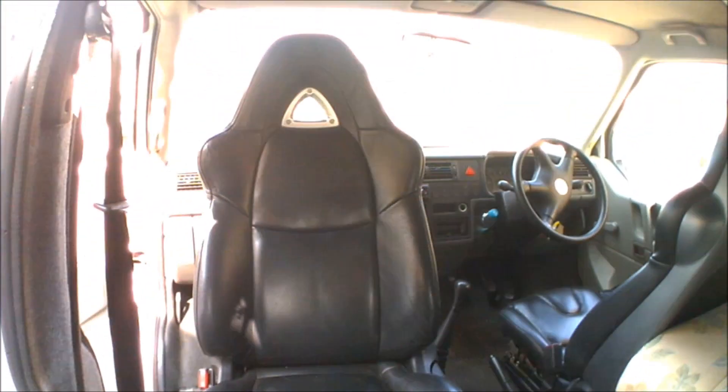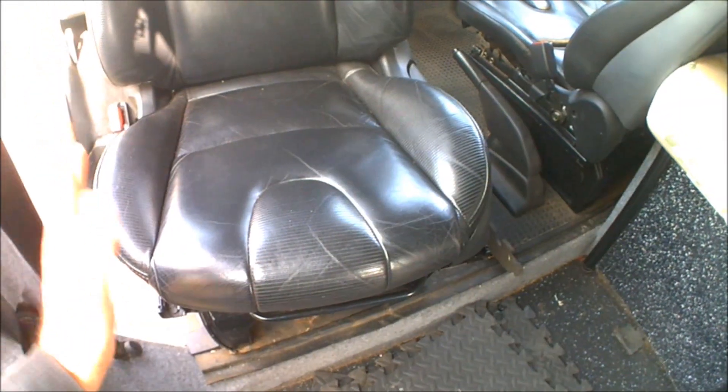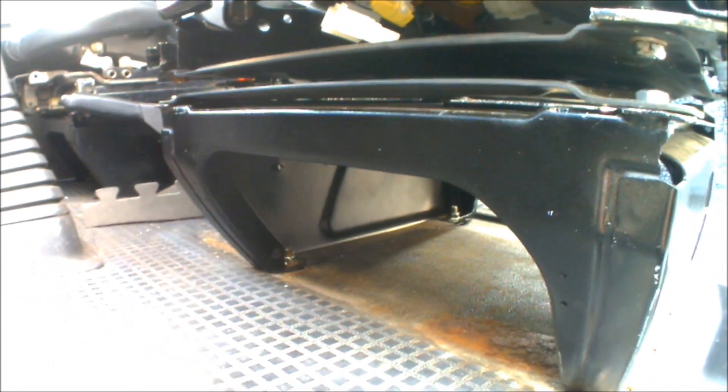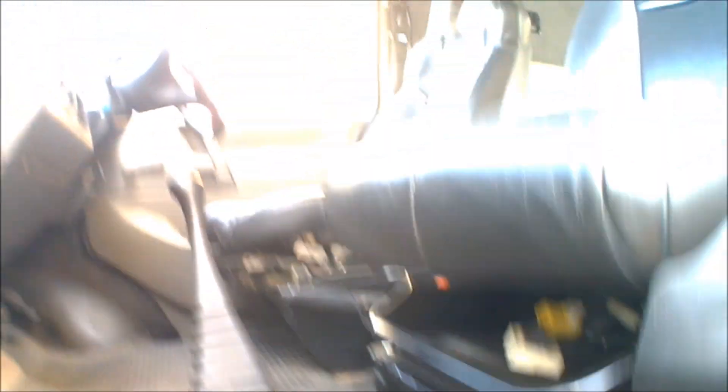The seat just folds back into its position again. So that's the passenger seat fully facing the back of the van, still free to move and swivels really easily — just a finger really. To put it back into position you just tilt the back seat forward and it spins round and clicks into place. So that's how I've fitted the passenger seat to the swivel base that's then mounted onto the standard T4 base, using extending bars on one side, original mounting holes on the other — pretty much the same procedure on the driver's seat as well.